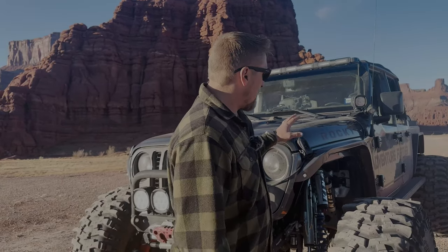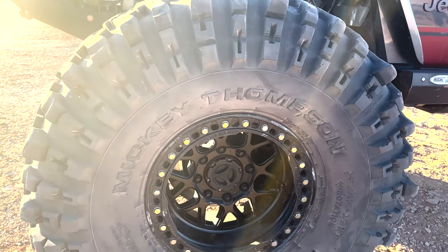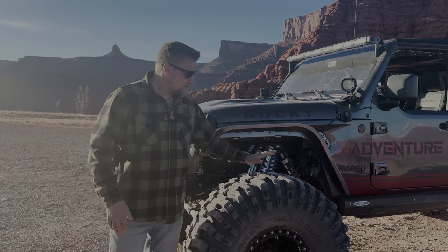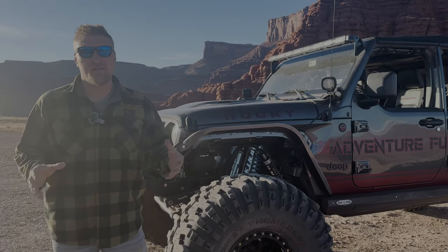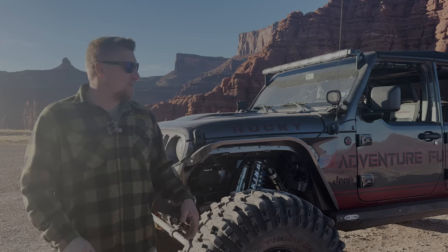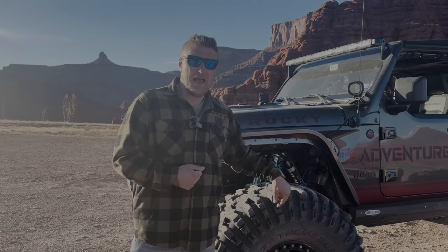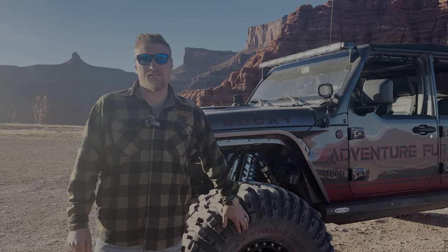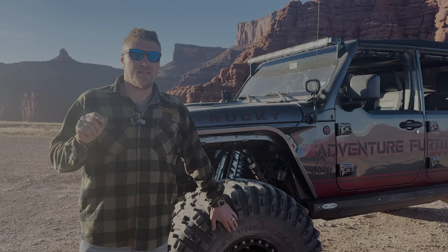Coming around, we're running one of our favorite tires — the Mickey Thompson Pro XS 43-inch DOT-spec tire, which is road-rated so we can drive it on the streets. Those are wrapped on KMC single beadlock wheels with Apex quick-deflate valve stems. When we get to the trail, we can get aired down very fast — within 45 seconds we'll have a 43-inch tire aired down from 25 PSI to 5 PSI using just an air gauge. Check out Apex Design USA — link in the description below.